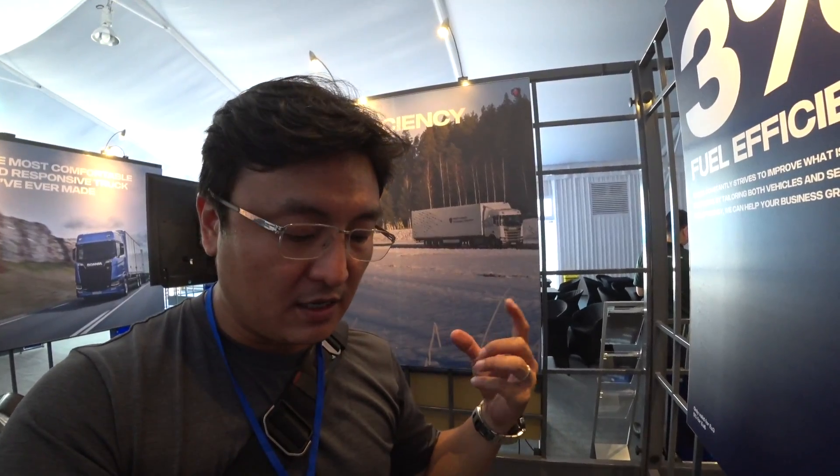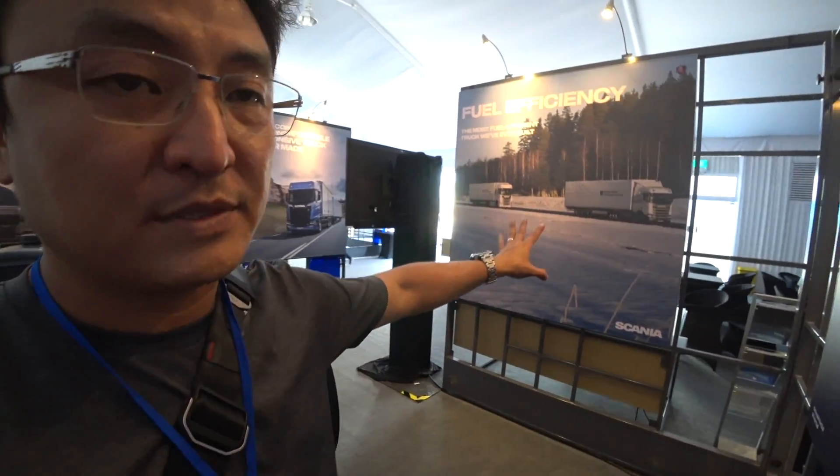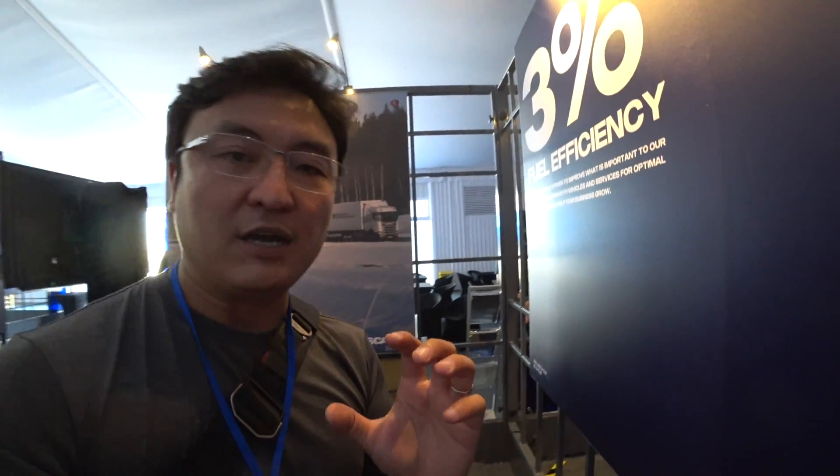So what's a retarder? The gearbox is over here. For city use buses with lots of stop-and-go, you'd have a torque converter gearbox. But for long haul, a torque converter doesn't make sense — it uses too much fuel. Instead, it's a traditional gearbox with a flywheel and clutch, which you can call an automated manual: an actuator operates the clutch and changes gears automatically, saving fuel. At the end of the transmission there is a retarder.